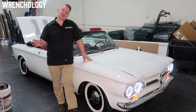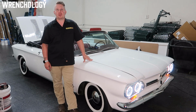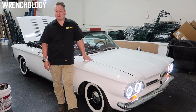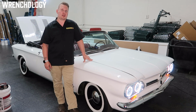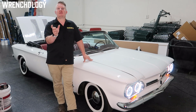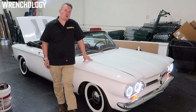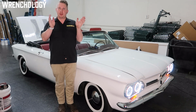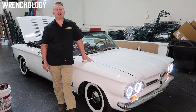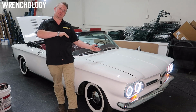We've never run it all the way empty like that though, and most, if not every EV owner out there will tell you that they try to keep some type of buffer, because they don't want to be stranded, mostly. But the other aspect is that it's better for the battery pack to keep it above that minimum voltage threshold. That 3.7 volt 18650 cell can go from 3 volts to 4.2, but if you can leave it in its more nominal range at that 40 to 60% charge, the cycle life you're going to get out of that battery is so much greater than if you were to charge it all the way up to 4.2 and deplete it all the way back down to 3 volts.